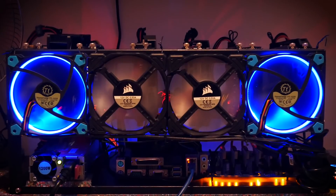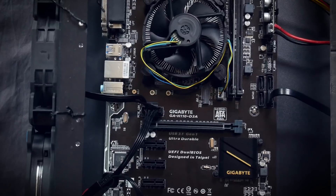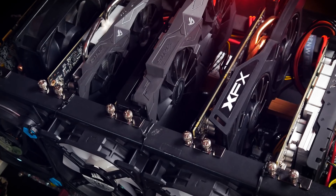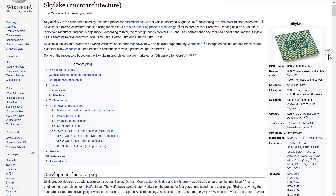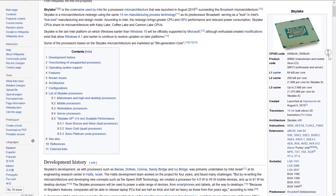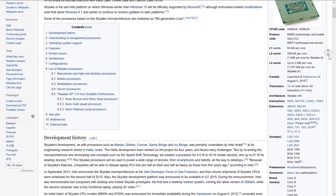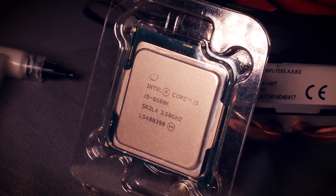Back when I built the AMD rig, I went for a good old H110 motherboard, so my possibilities for CPUs were limited. This means we have to go for LGA 1151 socket CPUs — and not the updated versions, but the original one. This leaves us with sixth and seventh gen Skylake CPUs by Intel, so we are talking quad core. I didn't want to go for an i7, but I went deal hunting and found an i5 6600K.